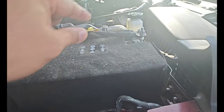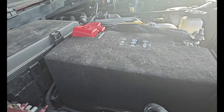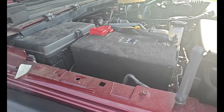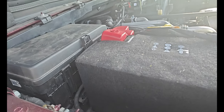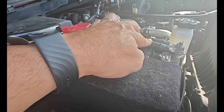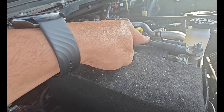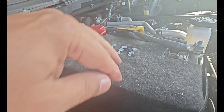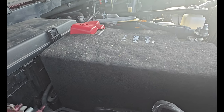But to me it's not good to go, so I'm going to go ahead and do what everybody else is doing: disconnect the fuse, pull out the F42 fuse, and disconnect the cable from the auxiliary battery. That'll eliminate the auxiliary battery entirely.